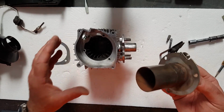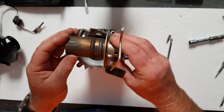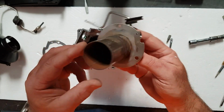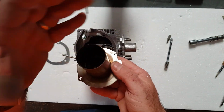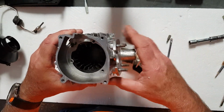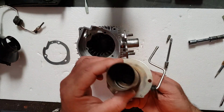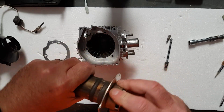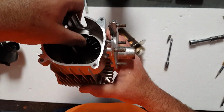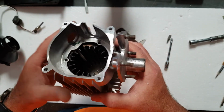That hasn't been used because we haven't used the heater since it was serviced. There's the fuel line. That's the blowtorch. Fuel comes in here. Glow plug heats it, and it basically just shoots out of there like a blowtorch into these fins. In this internal fins will heat right through to the external fins, and that's what's giving us our heat. There's not a huge amount of carbon in here. It's actually quite clean. There's a little bit of black soot in the burn chamber. It's unlikely that you're ever going to get all that out. That's very clean, actually. It's running very well.